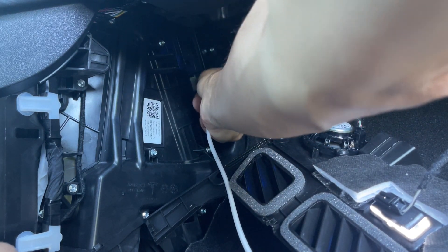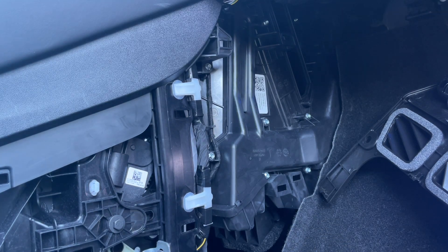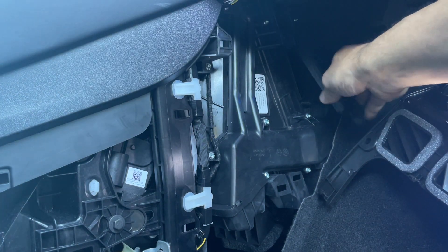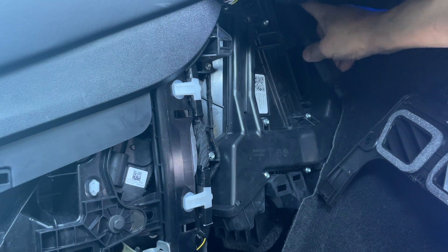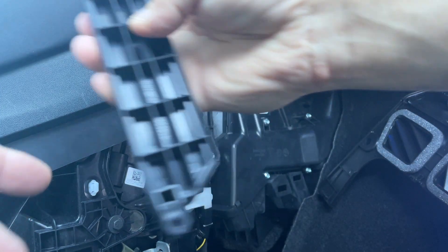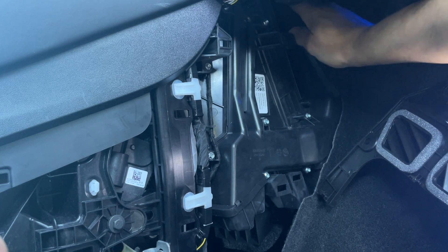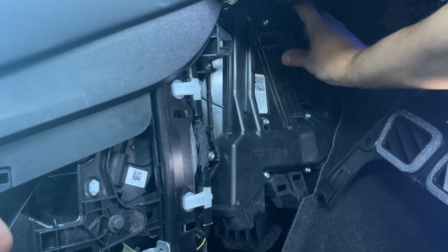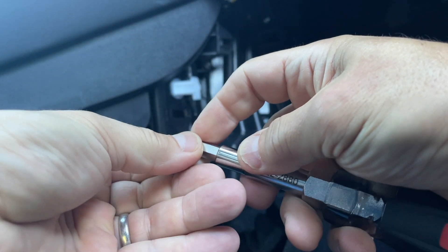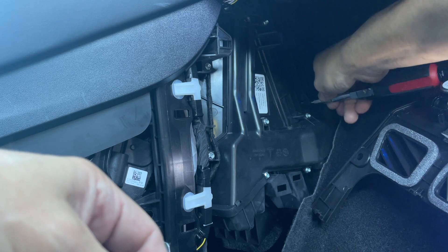The foam is filling the cavity — you can see it coming out, which is good. After it has sat for about 15 minutes, put the cover back on without the filters. This forces air into that compartment when you run the AC. Latch the top part first, then put the screw in with a hex driver — don't overtighten. Then run the AC for about five minutes.